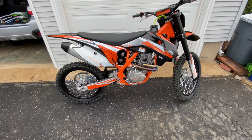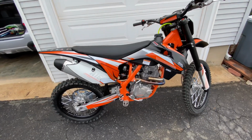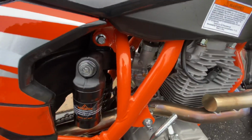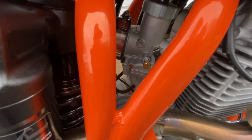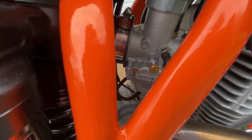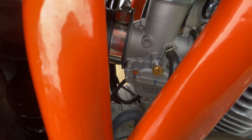Here it is, guys. Another video on the EGL A16. I will let you know, after doing a little research and riding the bike for a little bit, out of curiosity, I just wanted to see what the air screw was turned out, which I probably should have done from the beginning, but come to find out, the air screw is only turned one turn out.